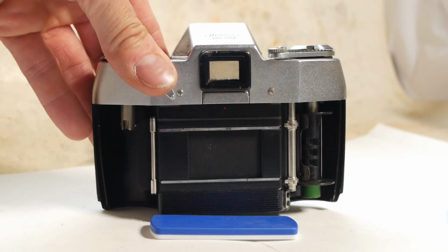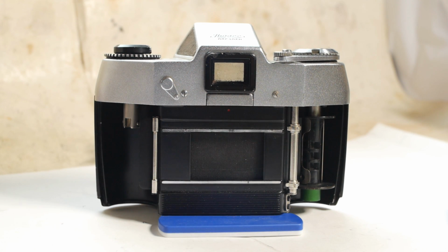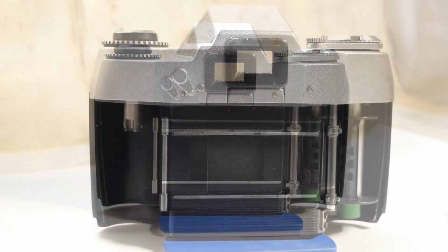If I now take a shot at 1/500th of a second, it's actually working, although it wasn't earlier. The front curtain had a lot of drag and the rear curtain would catch up with it before the end of the frame, which would of course have led to unexposed areas on the film, so it must have freed up a little through use.